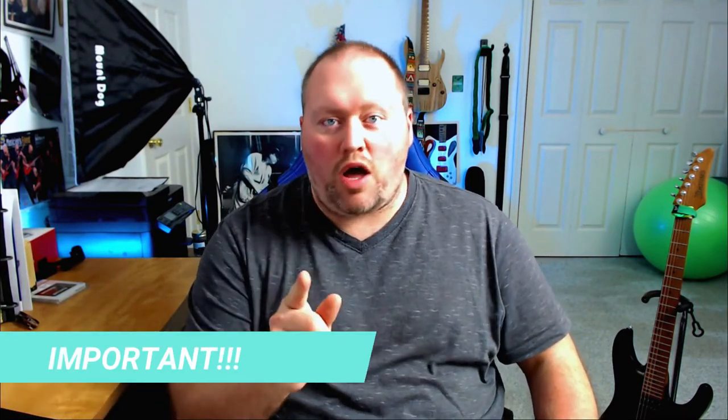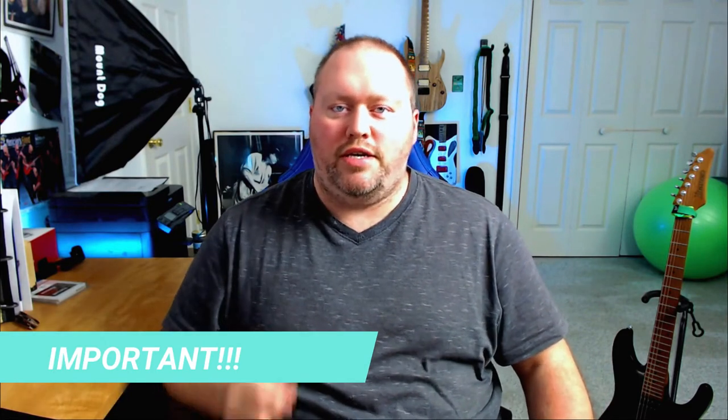Now, let me just tell you one tip that I learned. I actually recorded the first part of this video yesterday. I'm having to re-record this because I had the mic set up wrong the first time. You do not, I repeat, you do not need an extra phantom power for this mic. Why is that? Because the mic is powered itself. It supplies its own power through the lithium battery. If you try the phantom power with it, you'll end up with a very thin sound, kind of like this. Very nice sound quality we have right now.